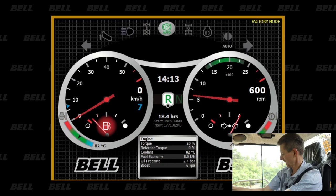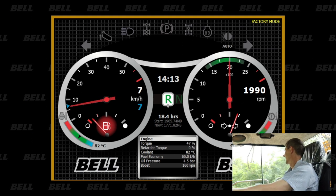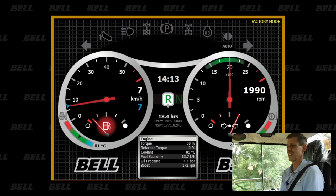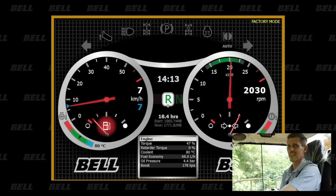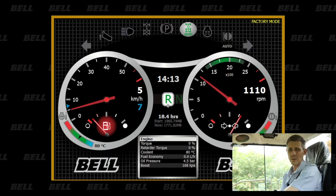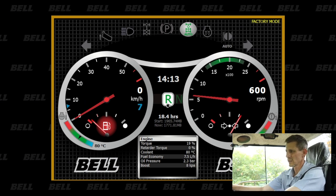We're now on the other side of the hill and we are going to repeat the operation, but this time we're going to do it in reverse and check how the traction control reacts when we are reversing up the hill. That time we had a little bit of a heavier detorque, as you felt and saw, but you can see the inter-axle diff lock has engaged. Automatic traction control got us up the hill in reverse.